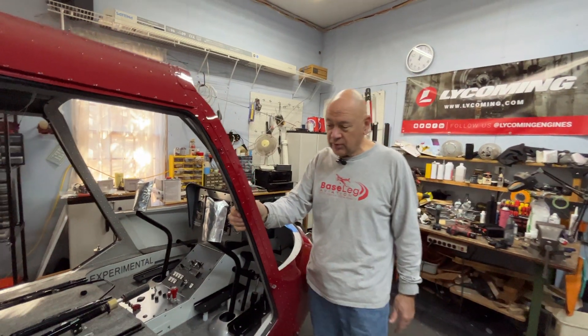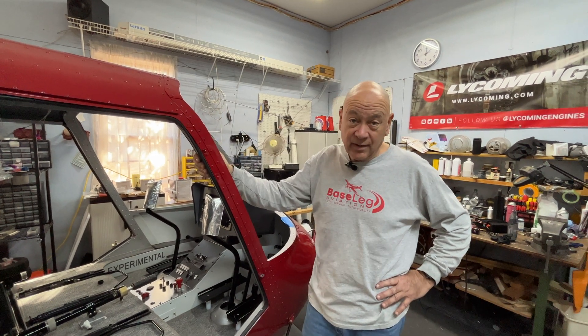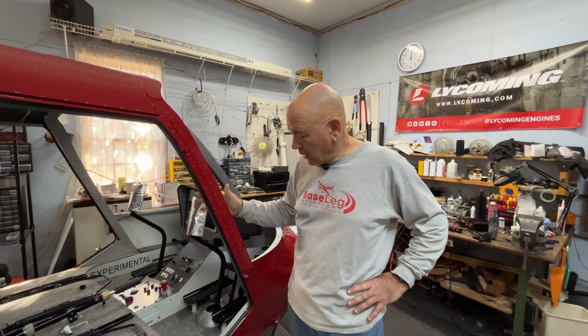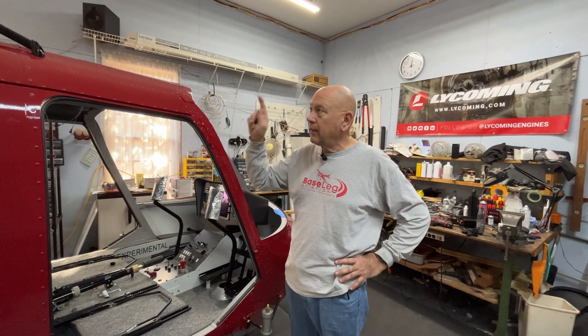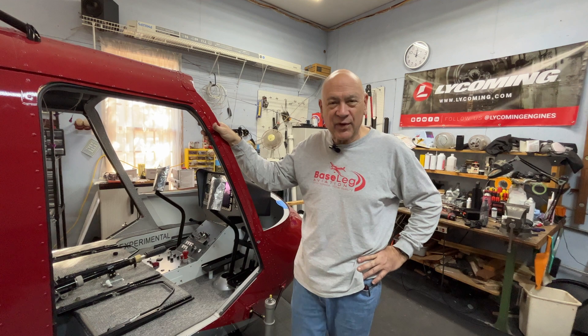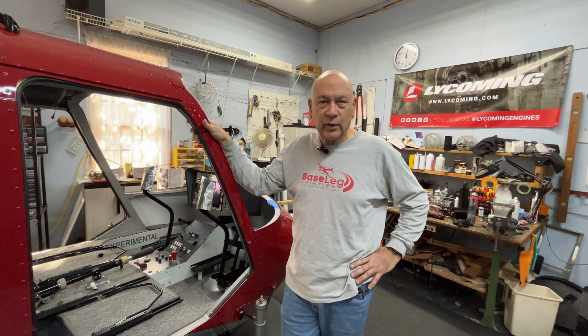So what's left? Home stretch. I've got to do the windshields — I'm not looking forward to those. I cracked the left one, so I've got two new tinted windshields now, which Carol is happy about given the southeast heat in this big bubble. The doors are painted and I've got gas strut actuators to install. I need to paint the cowlings this week, weigh the helicopter, then put the main rotor blades on and rig it. Fingers crossed, maybe sometime in February we'll be making some noise with the engine. We'll take you through the rest of it weekly, including the flight test program.